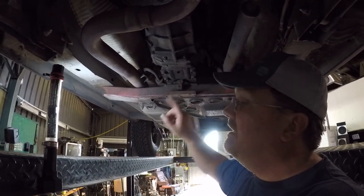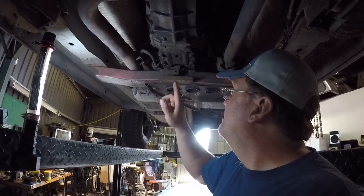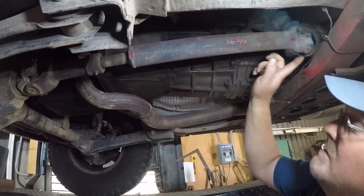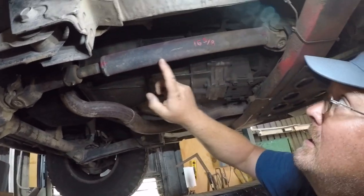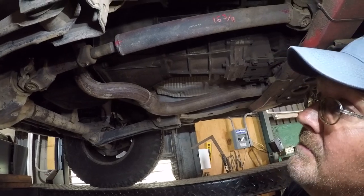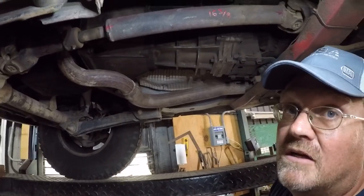You don't need to worry about this piece — that's actually a little camera I use when off-roading to check if I'm going to get high-centered or to see front wheel location in case I don't have a spotter. The skid plate is the factory ZJ skid plate, bolts right on. For the front drive shaft — it's the standard CV-style slip yoke. I like to measure the tube part: from weld to weld it's 16 and 3/8 inches. From end to center of the U-joint caps is 27.8 inches. If you're having a drive shaft made, that gives you a good idea of the front length.